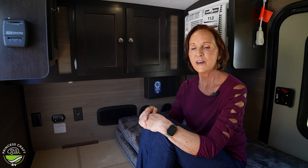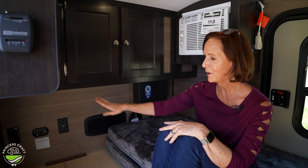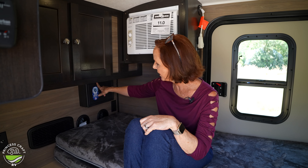On the right-hand side, that is where the connection is for the television. You do have that multi-directional TV antenna on the top, and right above here it says 'TV backer' with a little sticker. So if you wanted to put a small flat screen TV there, you certainly could. You'll notice the intake vent and the blowing vents — that's the furnace, and we saw it underneath the stove in the back, so easy access if it needs any service work. Right above that is the converter, which has the breakers and fuses and takes shore power and turns it into 12-volt.